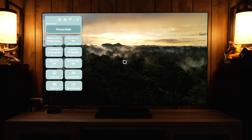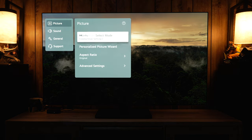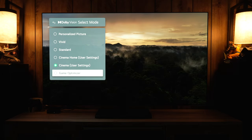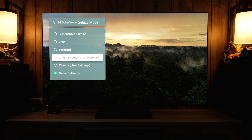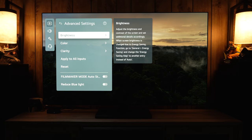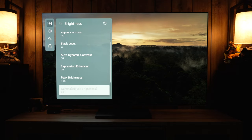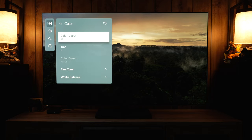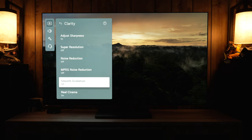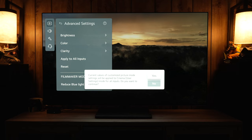Now I'm going to start some Dolby Vision content and go through Dolby Vision settings. HDR and Dolby Vision are a set standard for how bright content is supposed to be, and there shouldn't be deviation from that. However, if you're watching Dolby Vision or HDR in a bright room, it can be very difficult because it'll be quite dark. The Cinema Home setting addresses this. We'll start with Cinema as our Dolby Vision accurate mode — just reset the settings, and there's really nothing you need to touch out of the box. The only thing I change is under Clarity: put Smooth Gradation to Low, which helps smooth out big color steps especially visible in skies.